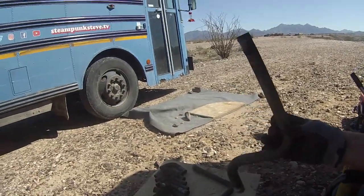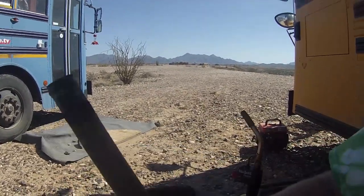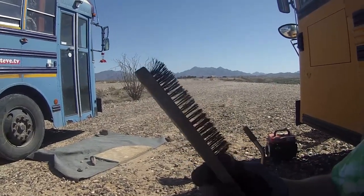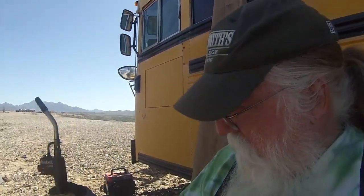The next step is putting this stuff all back together so the heater can be installed. I'm going to reuse a lot of these fittings, but after 26 years you get pieces of crud on these and the hose is just baked on. I can use a wire brush to try to get them off, but I think it'll go a lot better if I char them off first. I'm going to very carefully heat these up - hanging on to them with channel locks - char up the ends and then wire brush off the ash and get them cleaned up enough to reuse them.